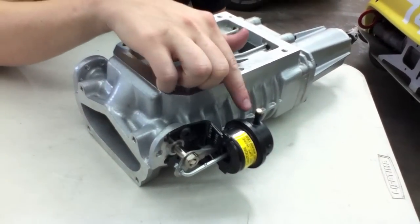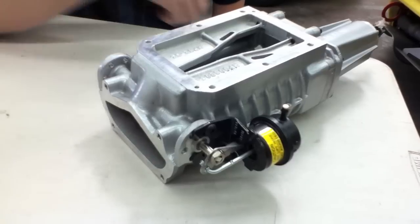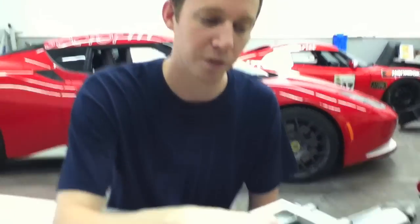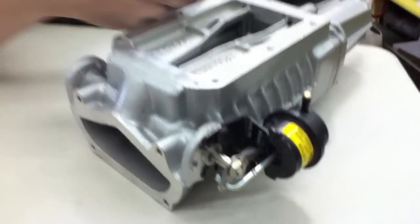The bypass valve is controlled by a hose that connects this little port right here to another port that sits in front of the supercharger. When you go to wide open throttle, that section of the supercharger goes down to a very small amount of vacuum and pressure becomes almost ambient — when that occurs, it allows the bypass to close. When running around at idle, there's vacuum present inside of here, and it pulls this open, which opens the bypass and allows air to go into the engine. Once you go to wide open throttle, there's no longer enough vacuum and the bypass seals up, so all the air goes through the rotors and into the engine. It's a pretty important piece of the system from a drivability perspective.